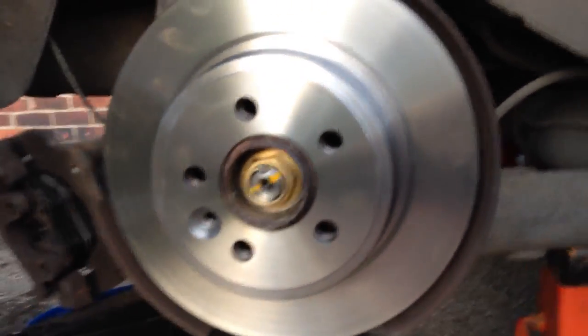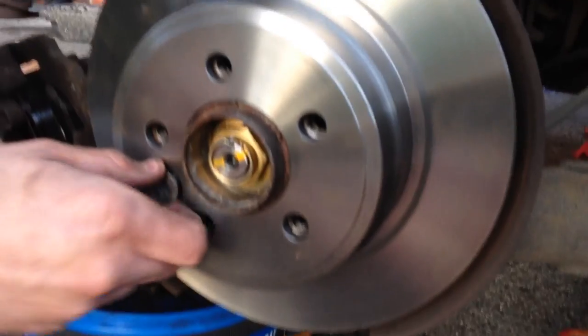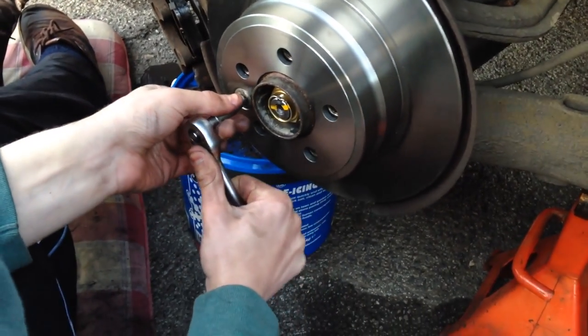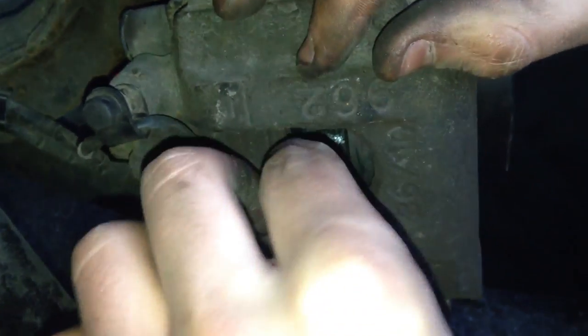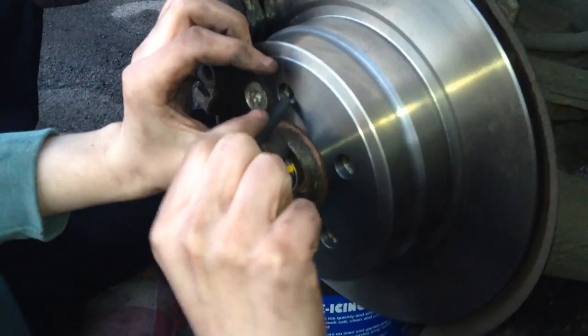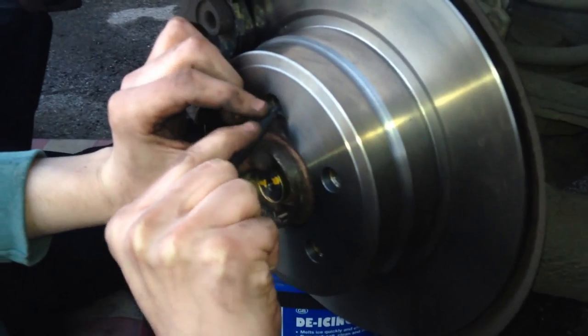Line it up to the top screw and pop that in. We've put the copper grease on — as we've learned, everything should be copper greased so it's easy to take off, even your wheel nuts. Looks like something's been eaten away. We're just reconnecting the sensor clip — insert it back into that little gap on the pad. Now putting the caliper back on — it should go straight on. Turn the handbrake adjuster, pushing upwards to tighten and downwards to loosen, then turn the disc and make sure there's only slight friction.